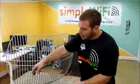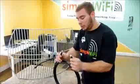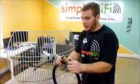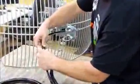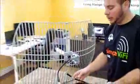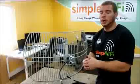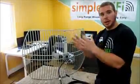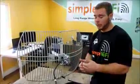The connector on the back of the antenna is an N-type connector. We suggest our LMR 400 cable that we pre-made here on our factory floor in the USA. N-type ready for the back of it, just like that. This specific cable has a TNC-RP connector on the other end so that your grid can talk to your router. This is for scenarios where you want to transmit your signal far away, you want to send it to a neighbor's house, or you want to send it to a specific location on your compound or barn, or just send it down the road, whatever it might be.